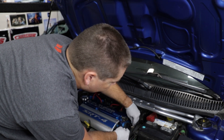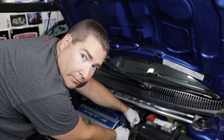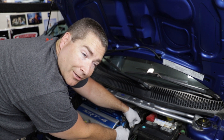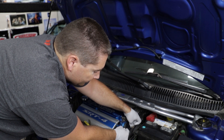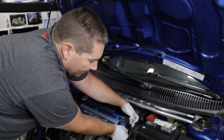Make sure you start the bolts by hand so you don't strip the threads — you definitely don't want to be stripping threads on an aluminum cylinder head. Once you get those in, just tighten them down, pop the electrical connector back on, and put everything back together.